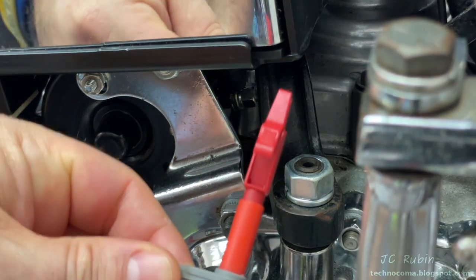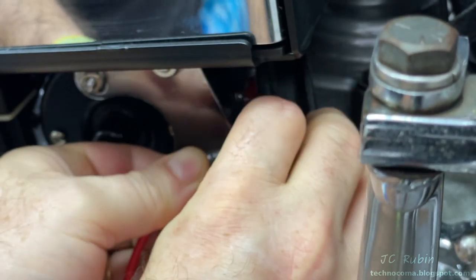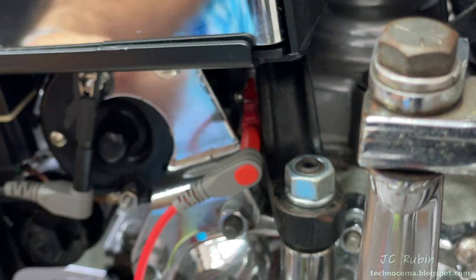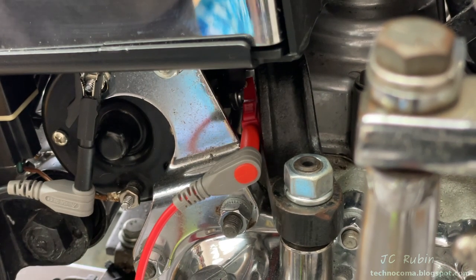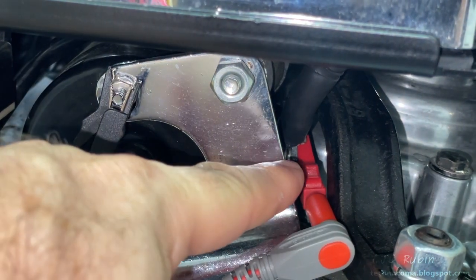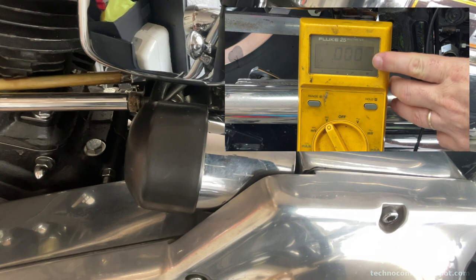There is a chance of course it could be the starter. During such a test, I'll use my alligator clip to clip onto that positive post there on the starter and the negative onto this long stud protruding out through the starter. It's imperative that the positive connection is not shorted to ground in any way or it's going to weld to something.